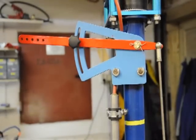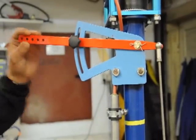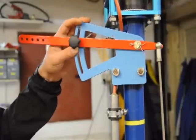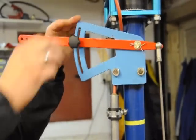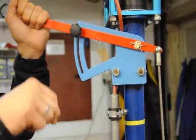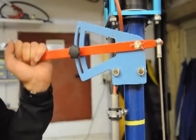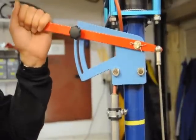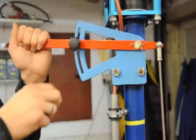Now the turbine has two main parts. The first main part is the lever mechanism where you can adjust the open and close position of the guide vanes — it's quite easy to do. You can open this screw and adjust the position of the guide vanes on the lower side, fully stepless and very easy. Once you find the desired position — fully closed, fully open, or anywhere between — tighten this nut and it's fixed.